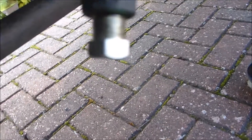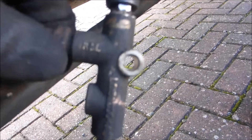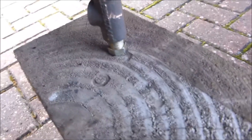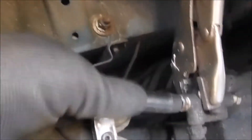To get this awkward one off, I've filed the faces slightly. These are originally 11mm or 7/16 imperial, but I'm going to drive an M10 socket onto it and hopefully get it off, because the steel nut has rusted and gone undersized. I went around each face lightly with a file, then drove the M10 socket on over a block of wood so it doesn't damage any threads — also putting a new bun nut in to protect the threads. That's cracked it and it's coming out nicely now.